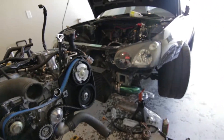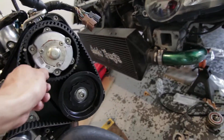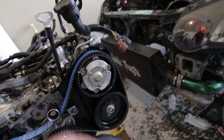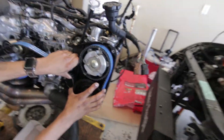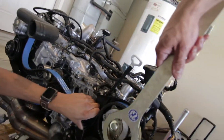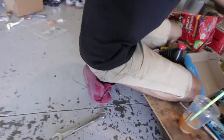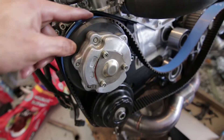This side is a little more difficult just because these valves are open, so it stops me from opening the valve further. We need to get the tools to get it lined up and then put the tensioner on — it's kind of a two-man job, at least the way I'm doing it. We couldn't really record it, but basically I turned this one way and José would hold the tension. Now I'm going to put on the rest of the timing components — this side is still in time.